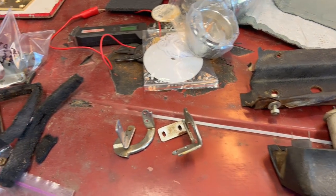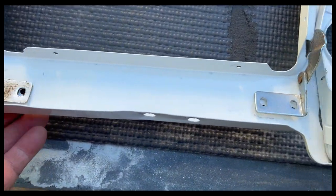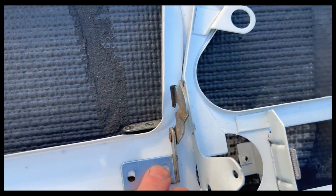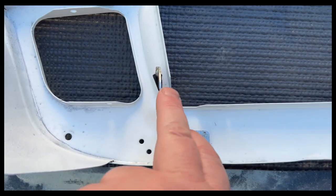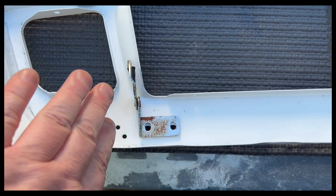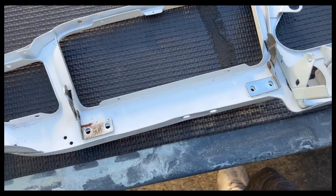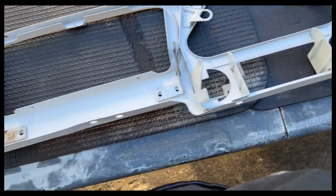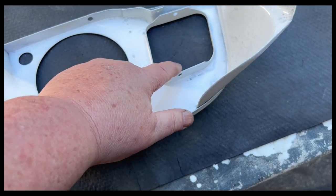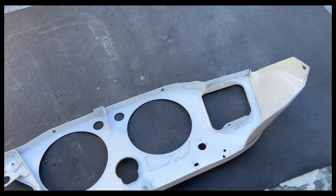I've got some metal polish to polish up the hinges a little bit, and those will be the first things reinstalled on the dash. The glove box hinges run through a slot to the front of the dash — you have to make sure they're in the right orientation. This one for sure will foul on the vent tube as you try to maneuver it through the slot in the front of the dash. Those are in place loosely. Now we'll go after the plastic vents that go in these spots, secured with a couple of J clips or spire nuts and a couple of screws.